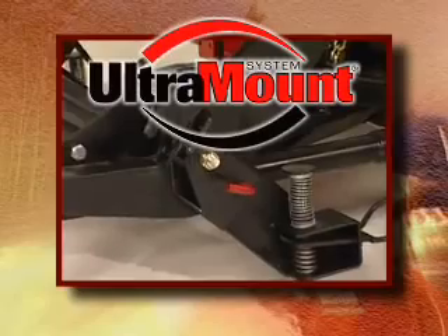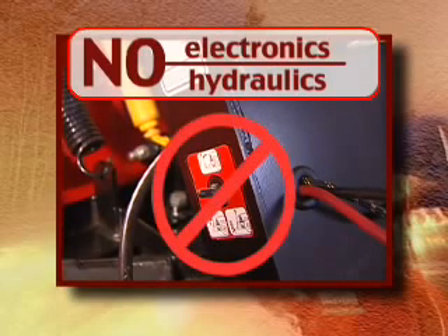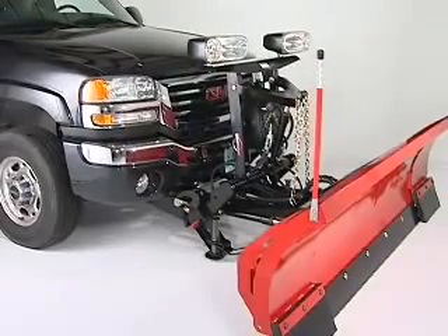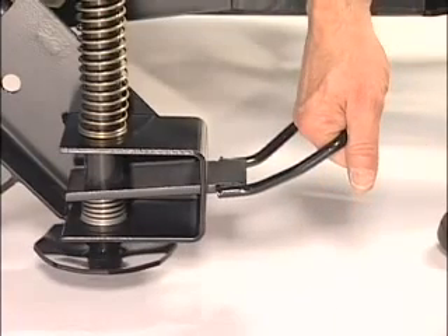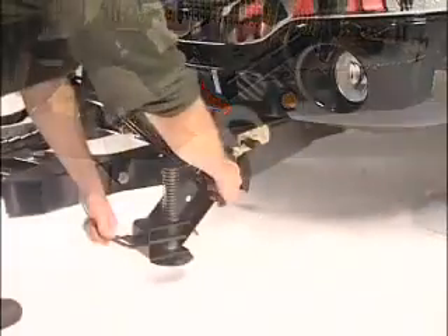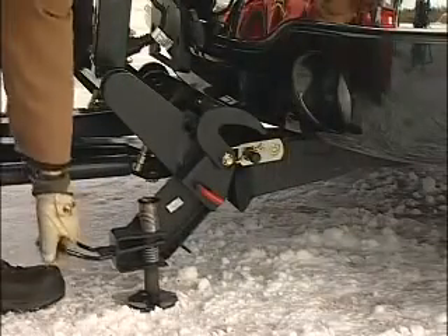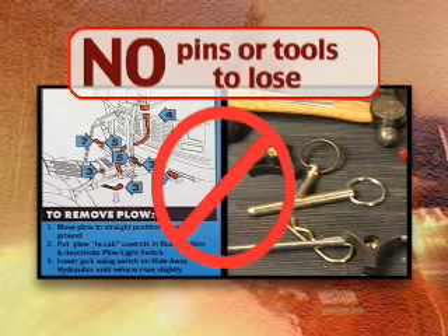It's quick and simple to attach the Wide Out to your vehicle with Western's proven Ultra-Mount Attachment System. While the competition relies on complicated and problematic electric and hydraulic systems, our Ultra-Mount is entirely mechanical and incredibly fast and simple. Drive in, and the large 3.5-inch flared receiver brackets help guide your vehicle into place — there's no need for optional side systems that other manufacturers offer. Then simply grab the shoe handle and pull it up. The spring-loaded shoe automatically pops up. Now pull the lock pin and rotate the handle up. Repeat on the other side, plug in the electrical connections, and that's it. We've combined the stand and the connecting hook into one smooth rotating device. The hook is designed to help correct for imperfect drive-in alignment. With the Ultra-Mount, there are no complicated instructions to memorize or loose pins or tools to keep track of.